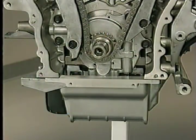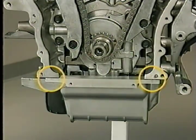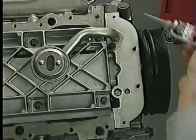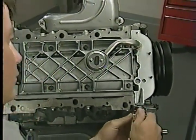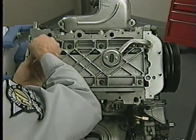As a result, there is less of a gap between components and fasteners maintain their torque better. The new gaskets minimize the need for sealant at mating surfaces. On the 2.7 liter engine, you need to apply Mopar silicone rubber adhesive sealant at only two spots where the oil pan gasket and timing cover gasket meet. On the 3.2 and 3.5, you'll need to apply sealant where the oil pan meets the block and oil pump housing in the front, and where the pan meets the block and rear seal retainer at the back of the engine.